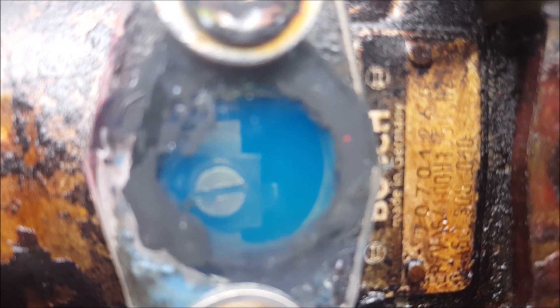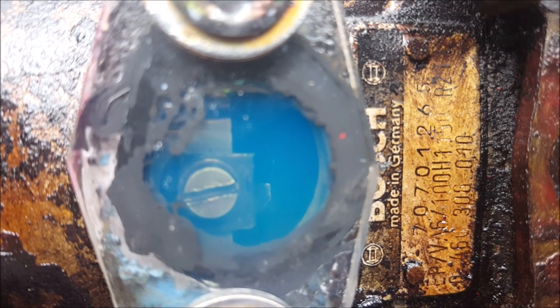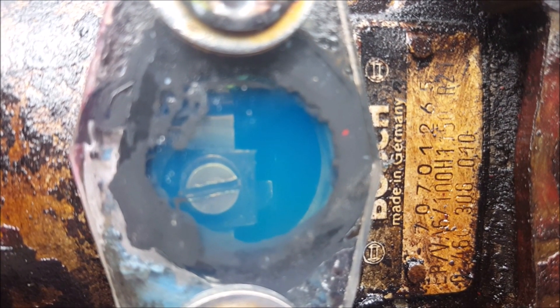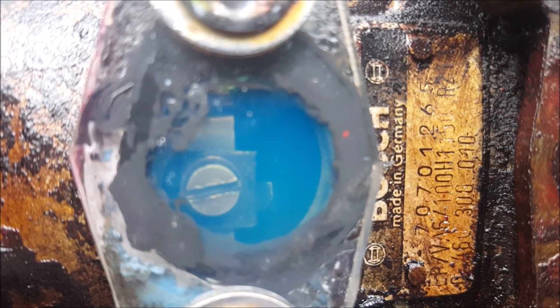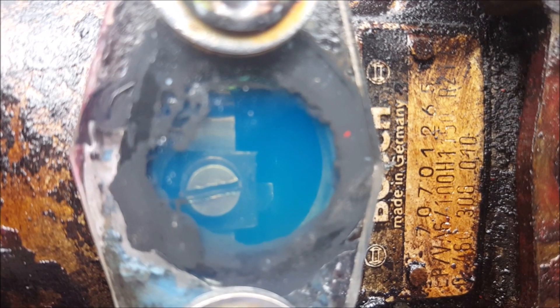It's hard to see in there, but my mark is a tad high, and that's why I have this all apart — I need to make that adjustment. That little bit could be a big problem; it could be a few degrees, and that will definitely show in the way the engine runs.